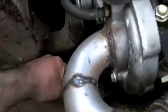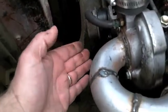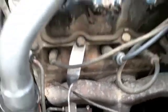That's how I got it shoehorned in there — there's actually quite a bit of room. At some point I'm going to have to redo my steering linkage, and I probably should have done that before installing it, but you know how life goes. I don't know how much boost I'm running. That's the boost control valve — I cut it open and annealed the spring so that I'm running quite a bit less boost. I'm not sure how much; I just don't want to blow it up. If I put a gauge on it and find out it's turning two or three pounds, maybe I'll bump it to four. If it's already doing four, I'm going to leave it alone.